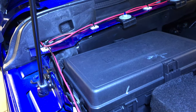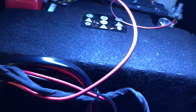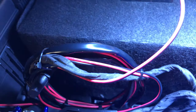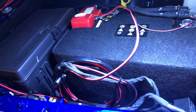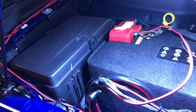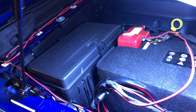Here it is all done, and I'm going to call this a wrap. You can see the cables are routed in and tucked down inside. I mounted the relay to this forward bolt right there, put a couple of spacers in between to space it out, and got everything connected to the battery. I'll probably be adding more lights in the future, so I might address the wiring and make it look a bit nicer then. Anyway, that's a wrap for the install. Stay tuned — if you like this video, make sure to hit that like button, please subscribe, and comment below. Thanks.